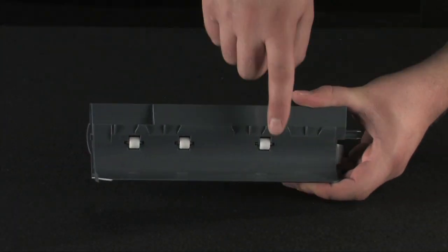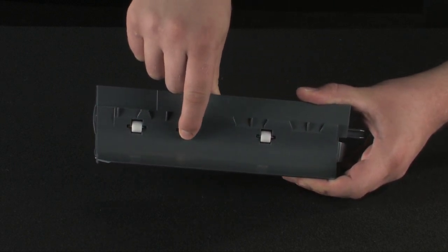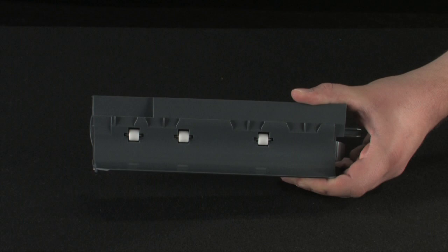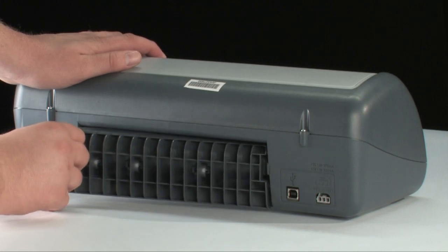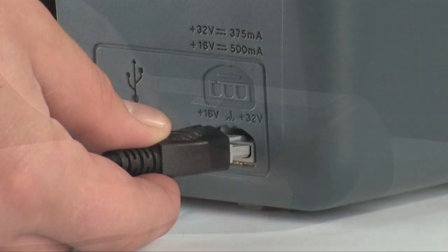While the rear access door is off, check the rollers on the door. Note if any rollers are missing, do not roll freely, or are not springy when you push on them. These conditions could mean the rollers aren't feeding paper, and that the rear access door needs to be replaced. Reinsert the rear access door and plug the power cord back in.